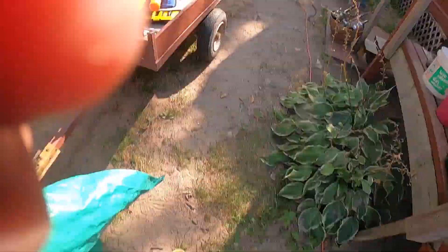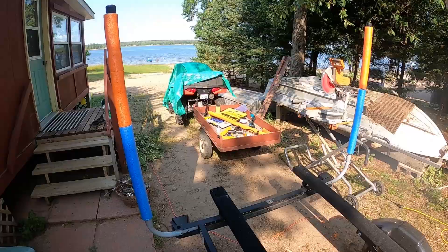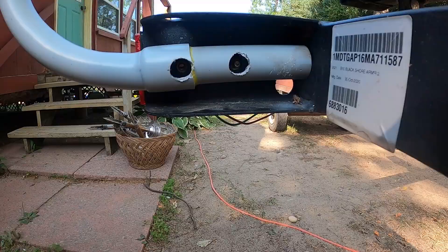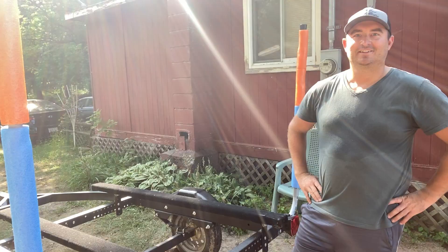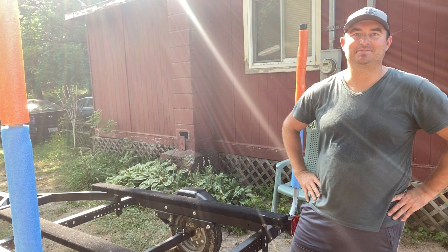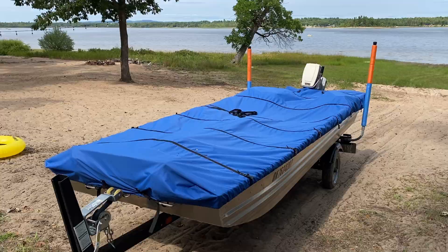There's my boat in the water way down there — I'll be taking it out in the next day or two to prepare for the tournament. Then we'll see what this looks like on the back of the trailer. That is the finished product — a simple, cheap way to put guideposts on your boat trailer using existing holes, bolts, and nuts, some one-inch PVC pipe, and pool noodles over top. The orange gives nice visibility when backing up. Hopefully you guys enjoyed this DIY tutorial. If you haven't seen my other videos on installing a floor and deck in my John Boat, make sure to check those out, and subscribe to the channel for lots more DIY projects coming up.